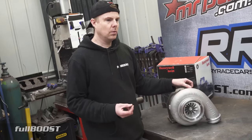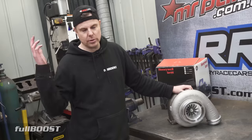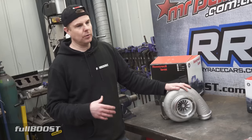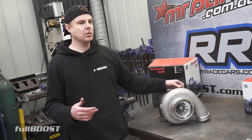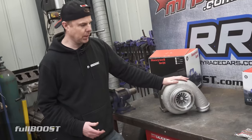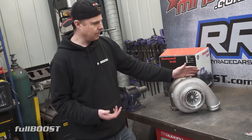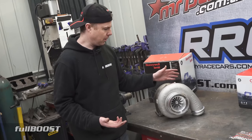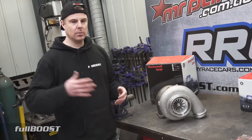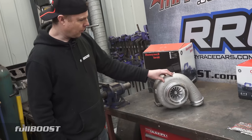The GTX42 probably has the potential on a two-rotor engine to run maybe 8.0s. Our goal is just to run as fast as we can reliably. With that turbo on maybe 50 pounds of boost, the wastegate would be shut — that's a hell of a lot of heat hindering the engine, and 50 pounds of boost is starting to get into pretty dangerous territory for the factory cast iron plates. So with this much bigger turbo we can run much less boost, and especially with no intercooler on methanol means less intake temps. On 35 pounds of boost we'll make the same power the GTX42 made on 50, which means better reliability, and also gives us headroom to future-proof the car.